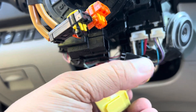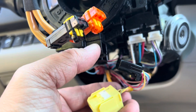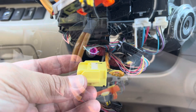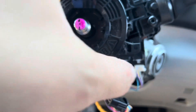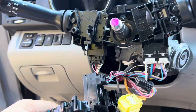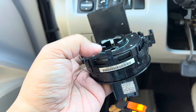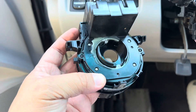This connector was here, this one was connected here, and this one was connected here — I used a flat screwdriver. I already removed everything — it's easy. All we have to do is pull it outside. There's still a wire connected, so we remove that too. The old one is now totally off the steering wheel.